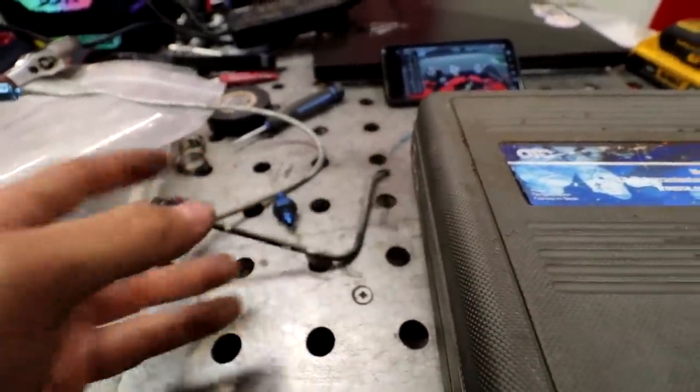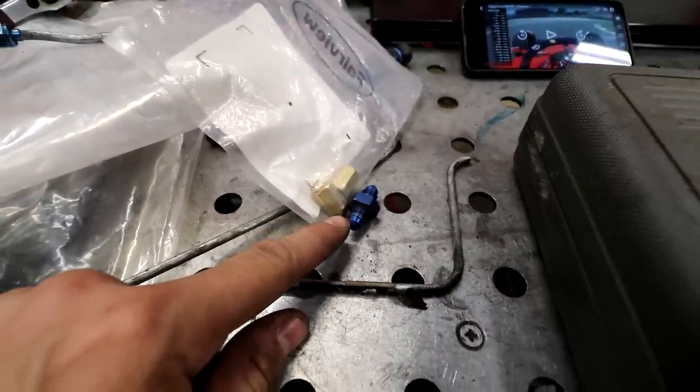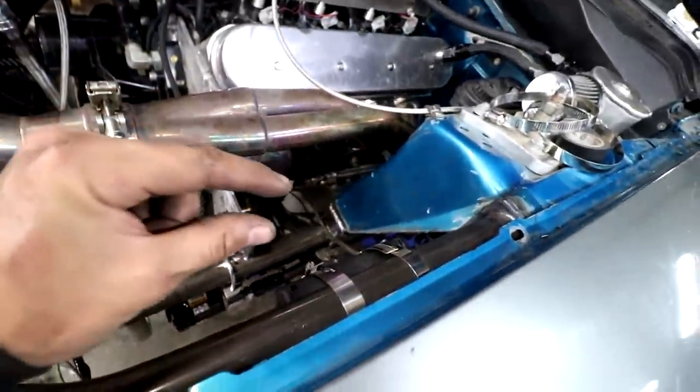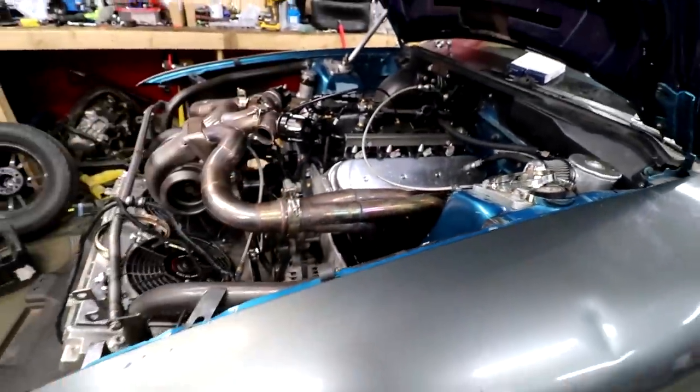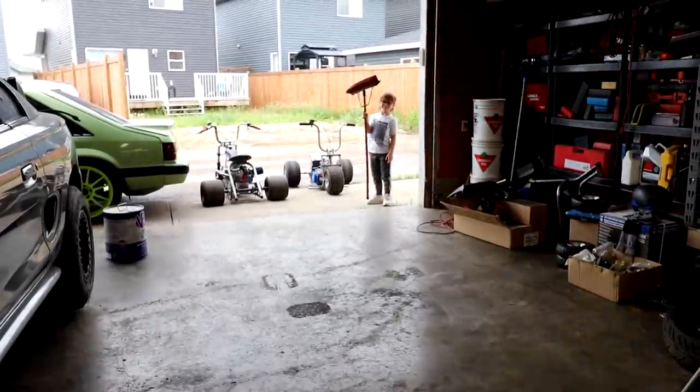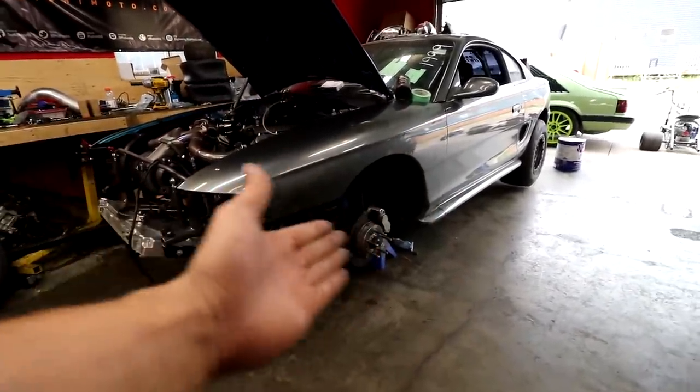These are 3AN lines. I don't have a flare kit for 3AN, so I got adapters for 3/16. What I'm going to do is use this section right here, put a 3/16 fitting on, put an adapter, and then go to where I need to go. Brakes are more important than no brakes. Brake line is through. I also ran the power cable down through there. The only thing I need is some P-clamps to clamp one side to the K-member, and a smaller P-clamp for the brake line and the power cable to run along that. I just bled the brakes and now we have brakes — ish. One step closer.